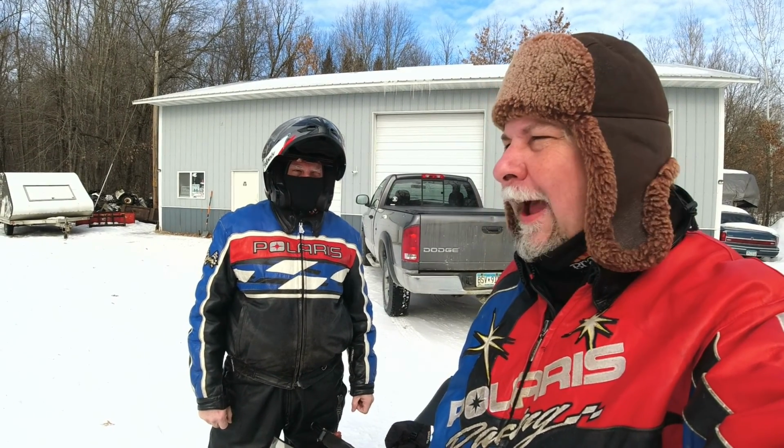She's still pretty boggy. This has got the original close face primary, and I think it's just shot. I mean, the secondary was junk. There's no reason to expect the primary is still good. Right. She's pretty boggy off the line. So, yeah, she's trail rideable, but we're not going to enter her in any drag races until we do a little bit of clutching magic to her.